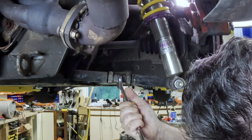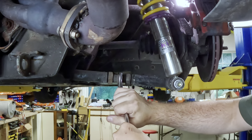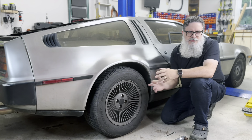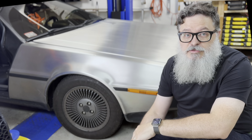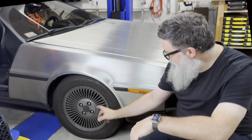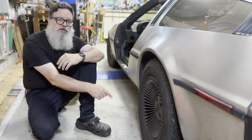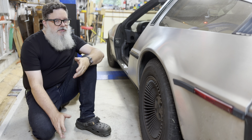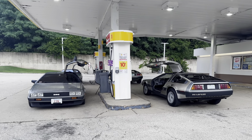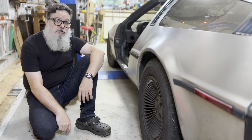While I was under there, I noticed the nuts on the lower link arm adjuster were loose — I'm not sure how that happened, but they were tweaked during the alignment. I snugged them back up. And while we're talking about things near the wheels — tire pressures. The fronts were supposed to be 23 PSI, but one was at 40. The other rear was down to only 15 PSI when it should have been 32. I think I have a slow leak there. I fixed it at a gas station halfway home, and it made the car much more stable on wet roads — I did not expect it to affect handling as much as it did.